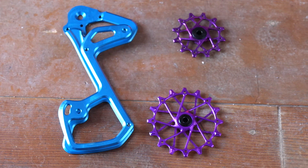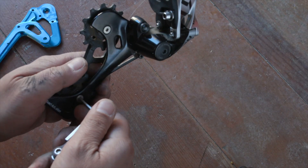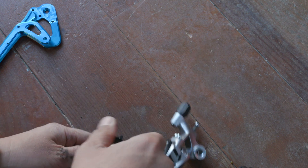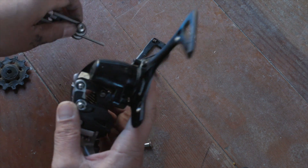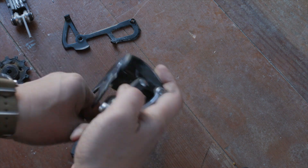You get the benefit of that wide range without all the weight and without going XD. But the real interesting star of the show has to be the SRAM rear derailleur long cage modification kit. I asked Garbaruk if they'd ever used that rear derailleur kit on a Rival rear derailleur, and they actually had not — so this was a first for both of us. I was a bit of a guinea pig, but it worked out okay. Basically, I took my SRAM rear derailleur, removed the pulleys, removed the derailleur cage very carefully, marked the pulleys with a sharpie so I knew which was top and bottom, and replaced it with the Garbaruk long cage and pulley wheels.